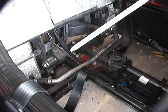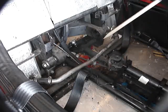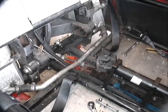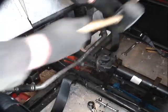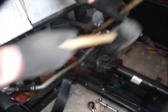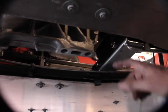Here we can see the rear cross beam of the MVH kit, which is held in place by two nuts and bolts going right the way through the chassis here and here. We take those bolts out and then we can knock these brackets down off the chassis tubes. Now the bolts are out, we find it a fairly straightforward business to drive those things off the bottom.